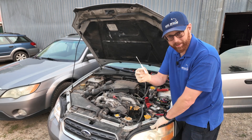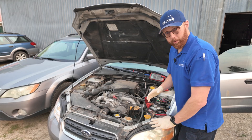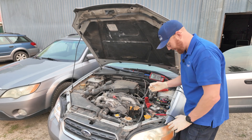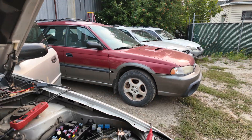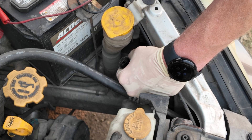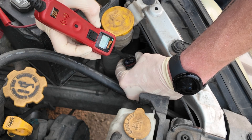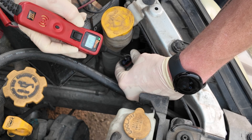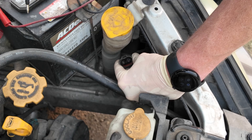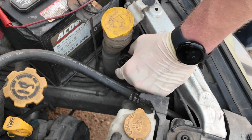Not following my own advice — always have one of these things on you. I even have a shirt with pockets in the arm so I always have a pocket screwdriver on me. I don't care if you're going to the grocery store, have a pocket screwdriver on you — you will always find a use for it. All right, so we've got our connector disconnected from our high beam. The first thing I'm going to do is test power — cool, we got ground — cool. You can see 0.3 volts and then 11.7 volts, so we've got some drop through this circuit because our battery is at 11.8 with the lights on.